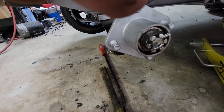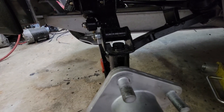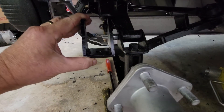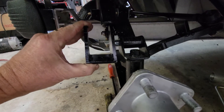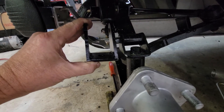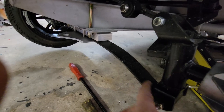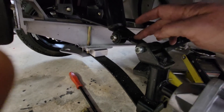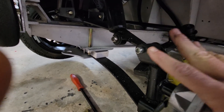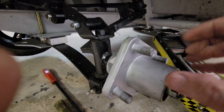We've got the wheel off and you can see how tall the OEM clevis is versus the new clevis we've designed — it's one inch taller exactly. What happens when the spreader bar is installed is it brings the leaf spring down one inch and the upper control arm has to follow. As it comes down it pulls the kingpin inward, which makes the spindle tip upward.